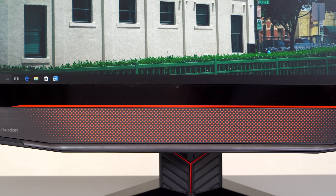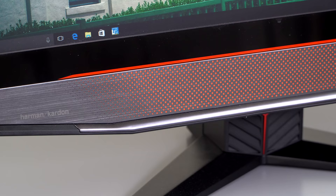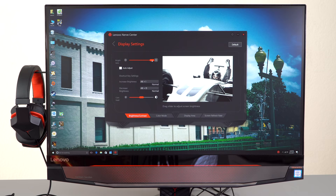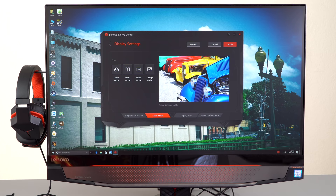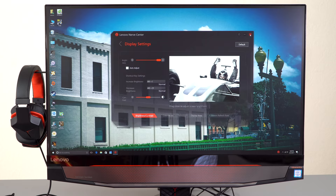Lenovo has a utility right on screen — their gaming center. You have display settings where you adjust the brightness. You can also use the NVIDIA control panel. There's no quick shortcut on the included keyboard. The basic keyboard and mouse — particularly the mouse — you just don't want it. Lenovo sells gaming keyboards and mice that are a lot nicer than the ones in the box. Here's where you adjust your brightness and there are a couple of different color modes. Game mode is kind of hyper-contrasty and desaturates at the same time. Design mode is kind of over-the-top saturation. I would not choose any of those and just go with the default, which looks perfectly nice and close to a decent calibration. You can also set the screen refresh rate — drop it down to 60 Hz for games like Fallout 4 that sometimes don't deal with high-refresh displays and V-Sync correctly.